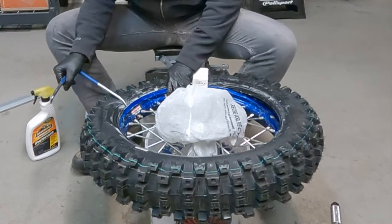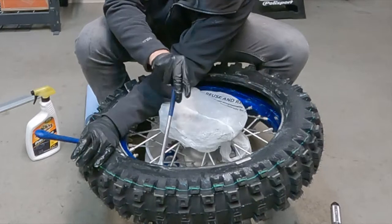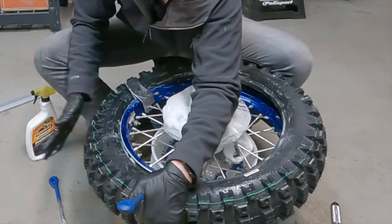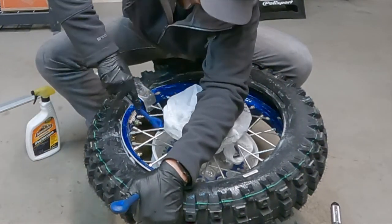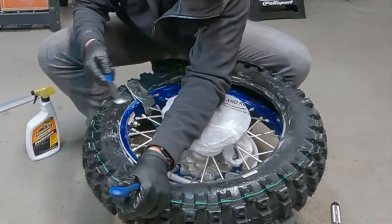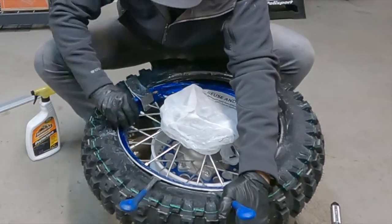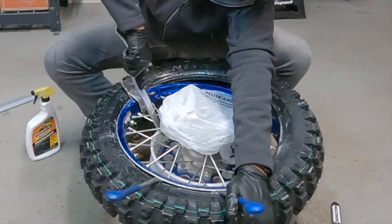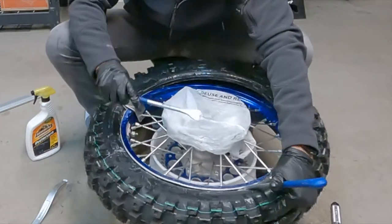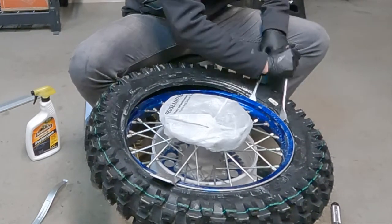I'm actually gonna try to get another bite on the tire because I think I need a little bit more pressure. So I'm just gonna go over here, take a little bite, like so. There we go, pull out that spoon, give that a little hit, give our little rim lock a little tap again. And I think we are just past it. Let's give it another bite, like so. Okay. Here's this spoon here. All right, keep us moving down here. A little bite. Another little bite.